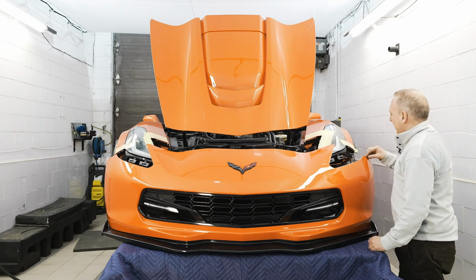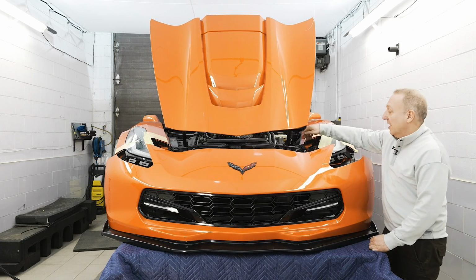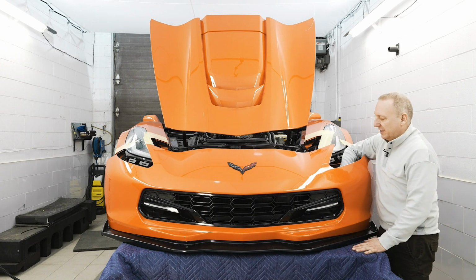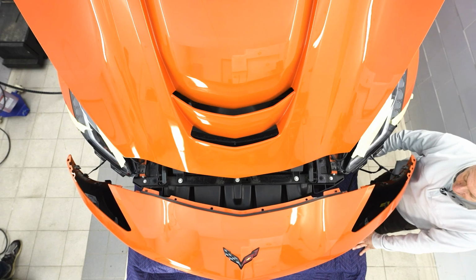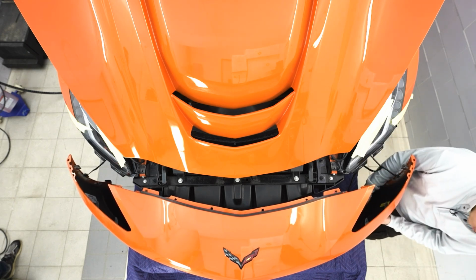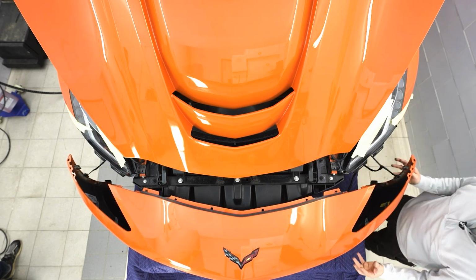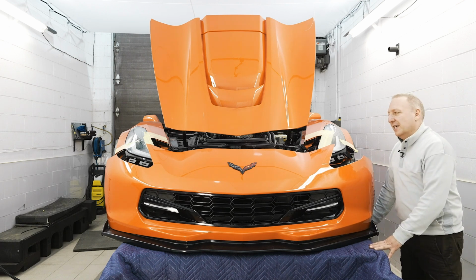Second, you want to get this tab over the fender bracket along with the upper fender bracket here. Once you have all that, you're obviously checking for clearance with the ductwork and also the lower under tray, or wheel liner, I should say. That tends to get caught in your lower bumper. So all this, you're sort of keeping track of what's holding you back to try to get it to the right position. Once you're done, then we'll deal with the snapping and the fastening.